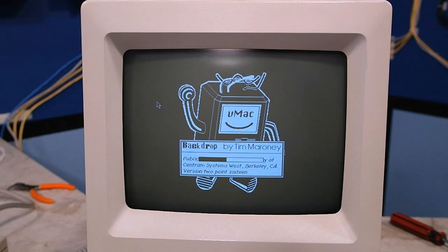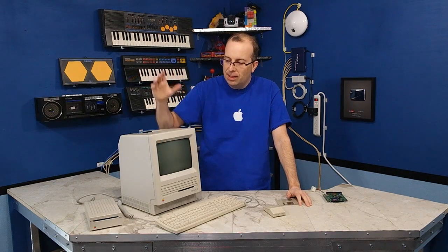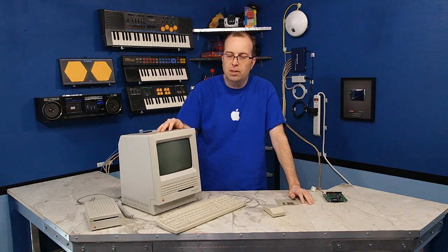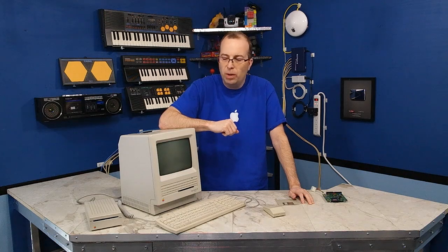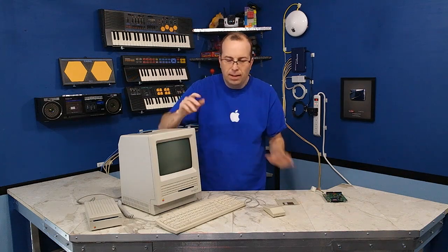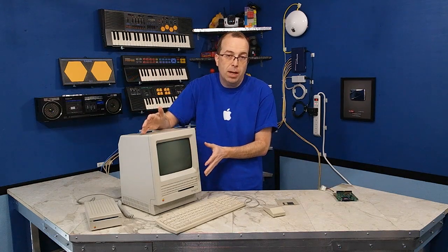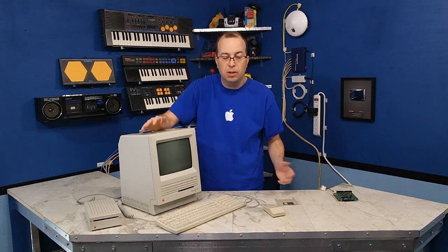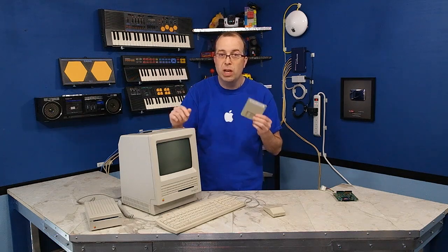I think we've come to the end of this project for the time being. I still don't know 100% if the SCSI bus in this computer is working correctly, and the only way I'll probably find out is to get my hands on an original SCSI drive — I know somebody who's got one and I'll try to arrange that. In the meantime, it's still not a total failure. While it's unfortunate that the SD to SCSI device didn't work, the machine is otherwise perfectly operational. You can use these things without a hard drive; you can run quite a few old games on just the floppy drive, it's just not nearly as convenient. The main problem is getting software over to these double-density floppy disks — modern USB floppy drives won't write to these.